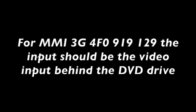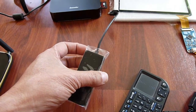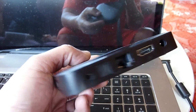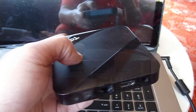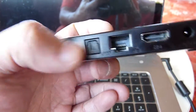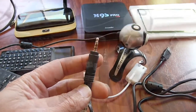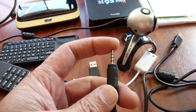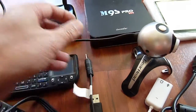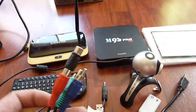The CarPlay is actually a dongle that works only on Android. This is one of the Android TV boxes we need so that we can use the Android Auto dongle. This Android TV box should have an AV output instead of using HDMI. For the AV output cable, you need to identify which ring carries the video — on this box it's on the second ring, and this one is on the fourth ring. So you have to figure out which is the correct one for your box. This is the composite output — the first ring is the ground. If you don't have the AV output, you have to use HDMI to composite, which is more work.